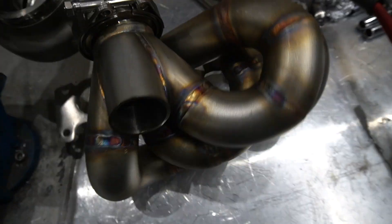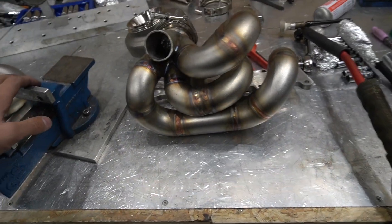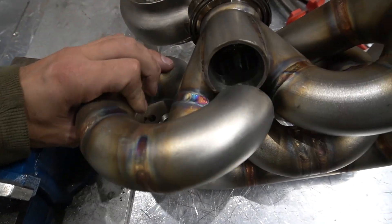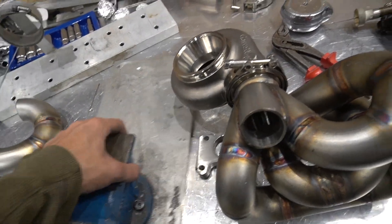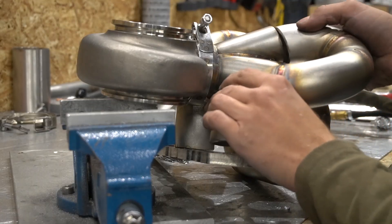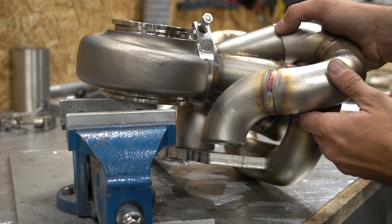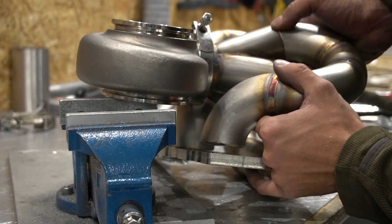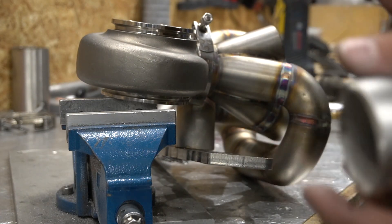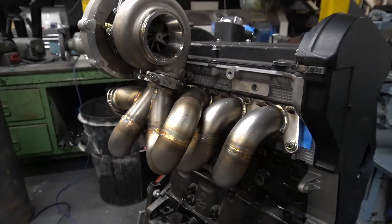I've got all three runners welded up and they look mint, to be fair. This last runner has ended up a bit short though for some reason — I have to either cut it up or just remake it. I need to see what I've got and whether any bits need adding. When I connect this up to here I'm ending up a little bit short. I've decided I'm just going to add a little piece in, weld that on — take a measurement, cut it, weld it. This is my tubular manifold all welded up.